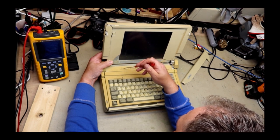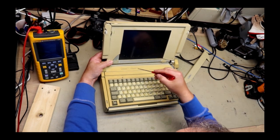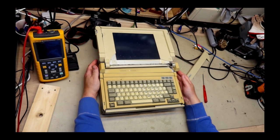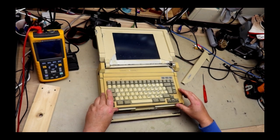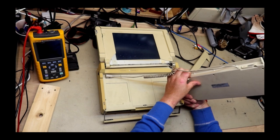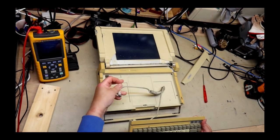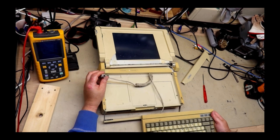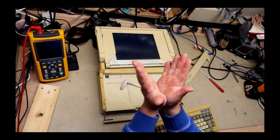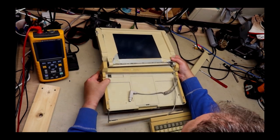I think this was a black and white LCD screen, probably a super-twist and not a TFT, as you can see it has both the light and contrast keys. The system is badly yellowed — you can actually see under the sliding keys that it used to be really white. You can also see it on the inside of the plastic. The handlebar was flipped, and this keyboard is detachable like it is on my Acer. This plug is damaged — all the pins are actually bent out like a star — so that has to be fixed.